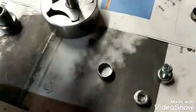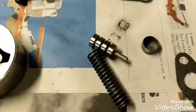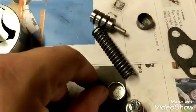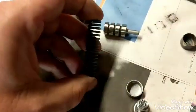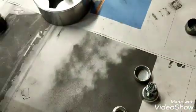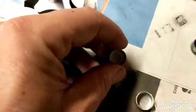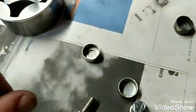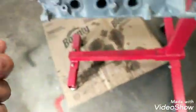And this is the little shuttle valve, and this is the spring. You can get through Summit a Canton kit that comes with a spring and a plug. The springs are light green — they're a little higher pressure. This is just the spring for a high volume pump, and you can boost the pressure, or you can put a couple really thin washers in there and it'll compress the spring a little bit more.